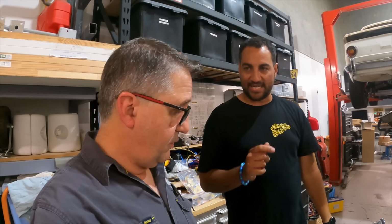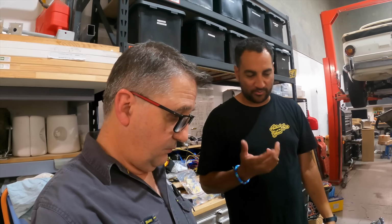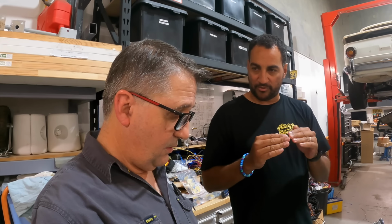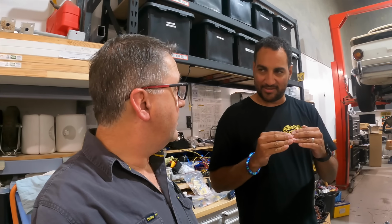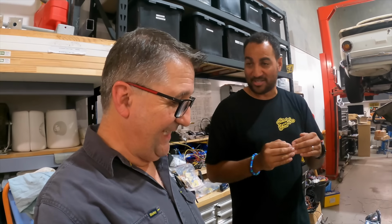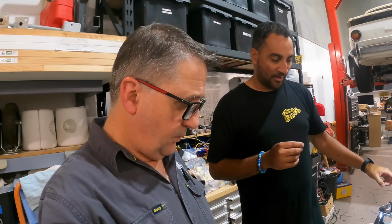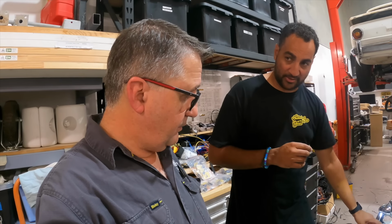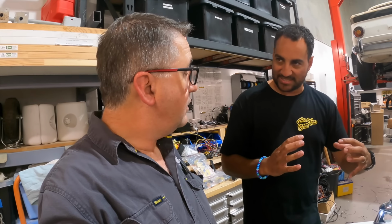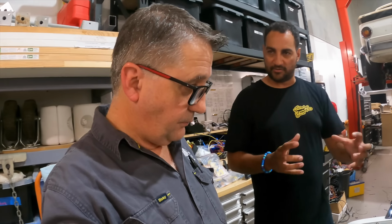The ECU will delay that for, I don't know, call it 1, 1.5, 1.2 seconds. We'll idle up with the throttle. Yep, just ever so slightly. It's probably just gonna be a crack, it won't need much. 0.3% will make that much of a difference with four. Well, now we've got four of them, yeah. And then we'll let the aircon output turn on. Then it will load up the engine and bring it down again. So what we want to do is have that seamless off down.